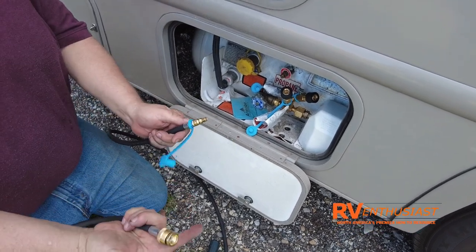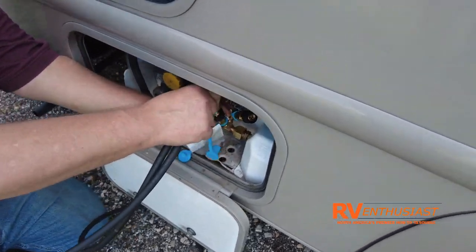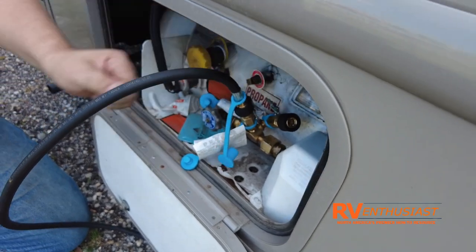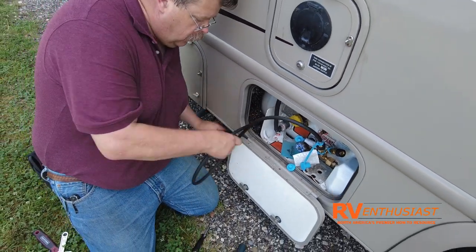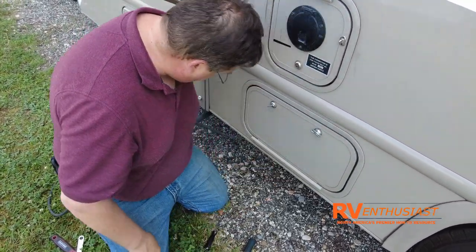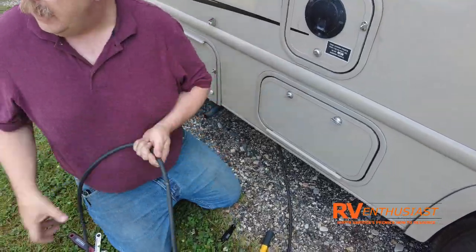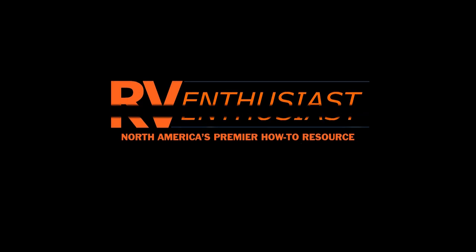To use it — for a grill, for example — here's our hose. Make sure the valve is closed, slide back the collar, plug it in, and turn it on — the gas is on. We route the hose through here so we can close our compartment door, the hose comes out, and we connect it to our grill.